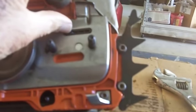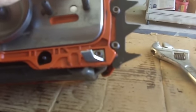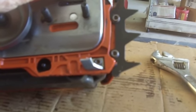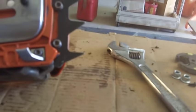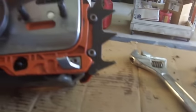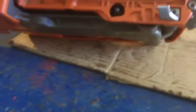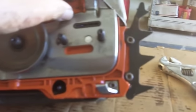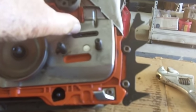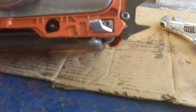This slot right up here is where the oil comes out to get on your bar. With the blowing, I would usually take that cover off and stick the blower in here and blow all the chips out, and I think I blew some wood shavings back in there and stopped up this tube. That's the reason it would keep leaking oil out into the case but not out onto the bar.